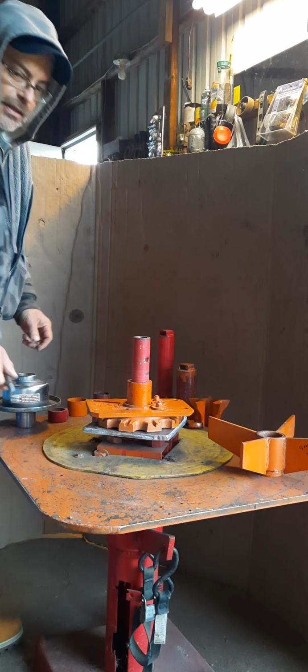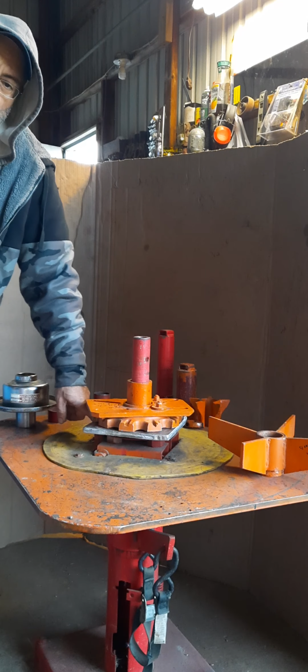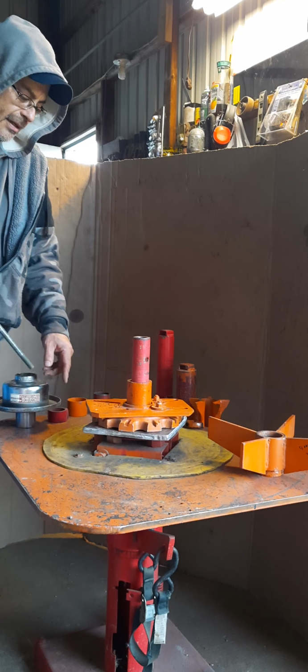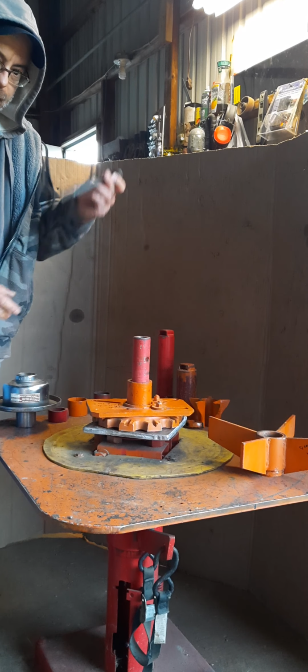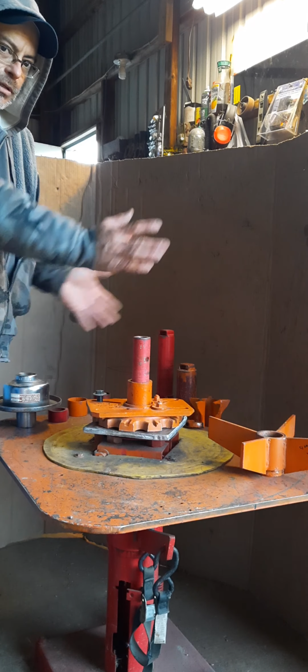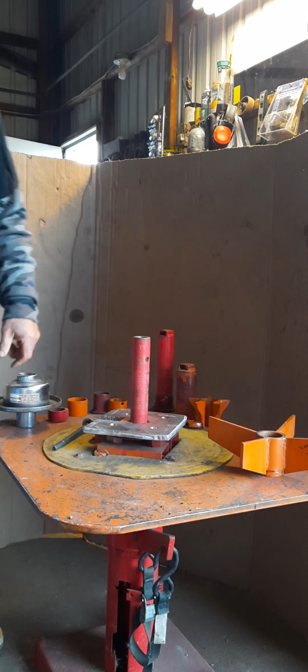That lines up. And on the old Coates machine, they had a pin that would pop up inside the lug hole to hold it in place. Instead, I put some shims inside of that, and I just use a heavy bolt. I drop it inside there so the rim won't spin. So I'll move this out of the way.